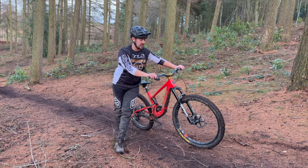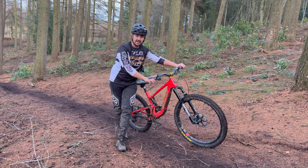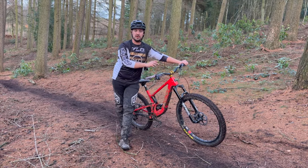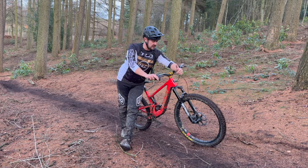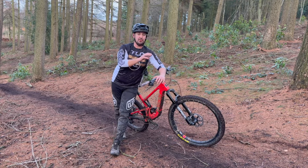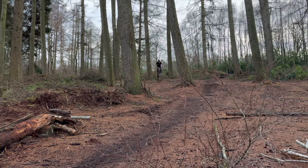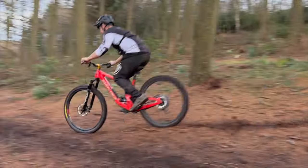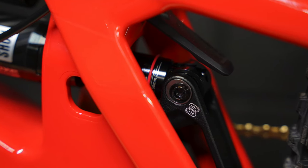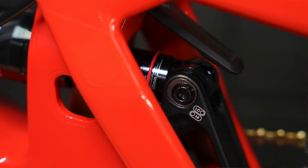You've got a planted feel on the wheels, the lower link is even more progressive now, and then the forks as well - the new RockShox. What I'd pick out on those is before I loved them for the small bump sensitivity, and the small bump is still there, but they do feel a lot more progressive now. Looking at geo on this large 5010, the head angle comes in at 65.2 degrees in the high setting and 64.9 in the low setting, easy to switch by flipping the flip chip on the rear linkage.